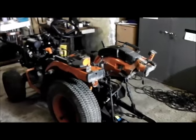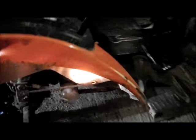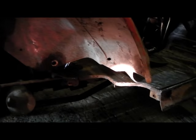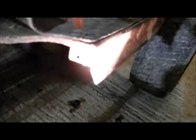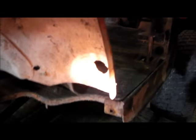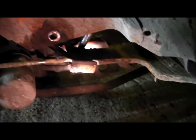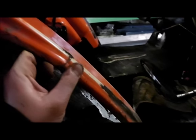Mechanically it's pretty sound, a bit noisy but it goes along quite well, but I'll show you some of the problems we've had with the metalwork. Everything underneath is really solid but the bodywork is really thin metal as you can see. For example, there should be a nut welded to the back of that there — you can see it's split and it's all rotted out. You can see the rot around that mount there, and that's the kind of thing that is typical on this, and then anywhere there's a mount there's a big split — the other side was the same.